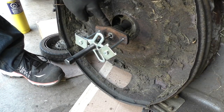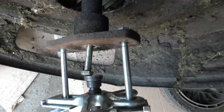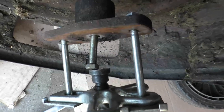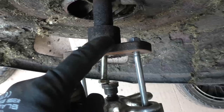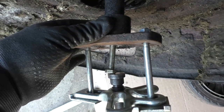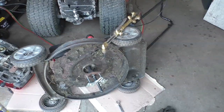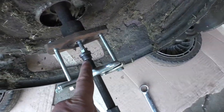If you're hitting a snag like I am right now, or even the puller won't do it, you're going to need to heat up the blade adapter. As you can see, the adapter is not budging at all — it's actually bending the bolt. So I'm going to get the acetylene torch out and heat the exterior of the blade adapter. It should come off quite easily after that.